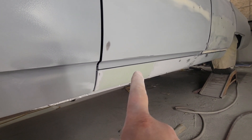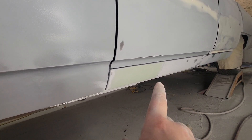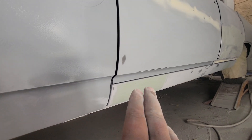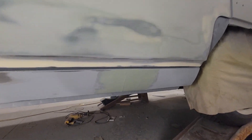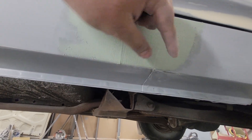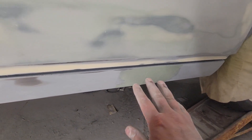On the rocker, there was just a little bit of low spot right here, just low enough where I needed to use some filler. Don't use Bondo brand Bondo — it sands like crap, you'll hate it, so don't use Bondo brand Bondo. I got a skim coat there coming along, got it blocked out. It looks like low spots but it's all nice and flat. Right here is a factory lead seam, and if you go underneath you can see where they overlapped it and then right here would have been some lead. It wasn't bad — factory approved — but it's not domino approved, so we're filling it.